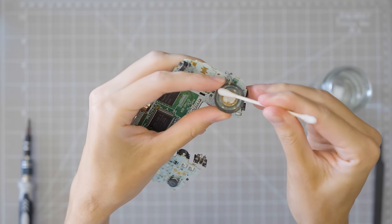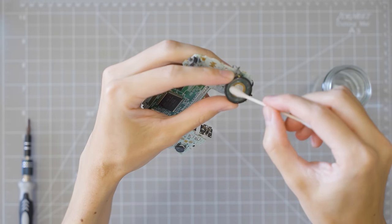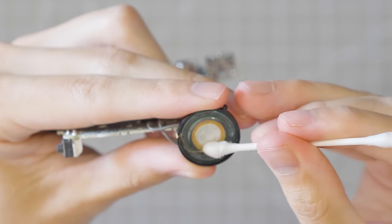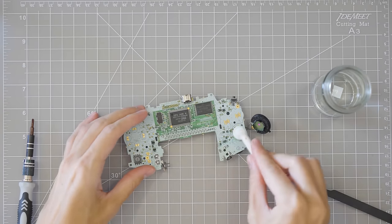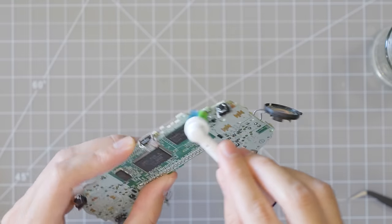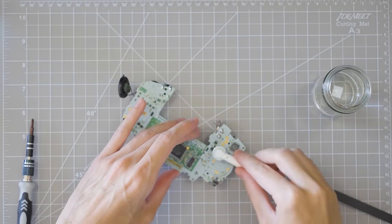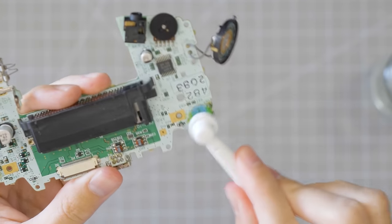Let's start with this grimy speaker — just a bit of isopropyl alcohol. There's like little metal bits inside that don't want to come out because the speaker magnet just keeps pulling them back. The technique is literally just grab it. Now it's pretty clean already, but I'm going to go ahead and give the whole motherboard a quick scrub with some isopropyl alcohol, especially around these areas that were kind of open, like the volume wheel here. Clean up the power switch, and right here around that R button was kind of the dirtiest part.